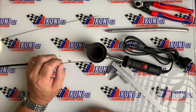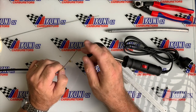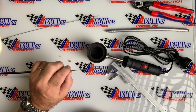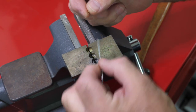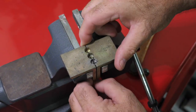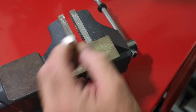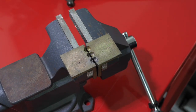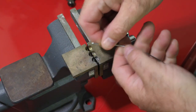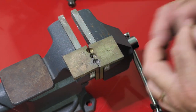Now we'll go and show you our bird nesting tool, which is not something you're going to have at home. The tedious bit at home is you're going to need a pair of long nose pliers to try and duplicate what we're just going to do with a quick hit of a hammer and a tool we have here. So here we have our bird nesting tool. We just slipped a nipple over the end of the cable and put this in the tool. I'm just going to set it at the right height, tension it up, and just one bang. This is all nice and simply done. We've got that hollowed out end, so you see we've got a nice little bird's nest there. And with a little pull, that bird's nest just pops inside there — by the time it's soldered around that, it's permanently there.